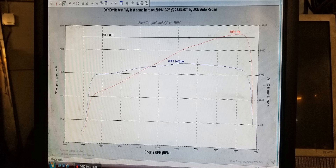The other thing I want to mention: this was dynoed on a Dynamometer Land and Sea chassis dyno. If you dyno the same car on 10 different dynos, you're probably going to have 10 different results. At the end of the day, the dyno is just a tool for tuning and to measure and observe changes. Because we did a before and after, we're strictly measuring the gains we were able to see. As far as what the horsepower numbers mean, you're really going to see that on the track rather than just racing dyno sheets.